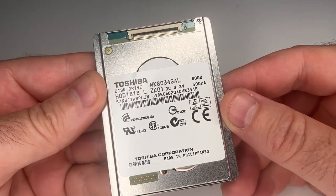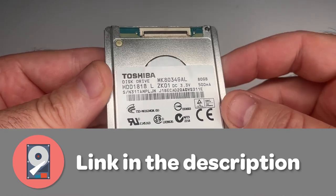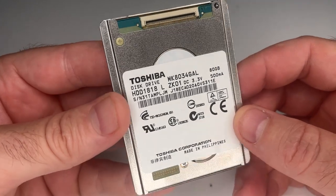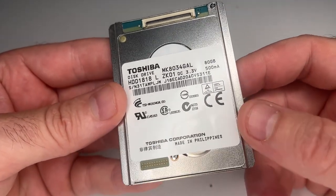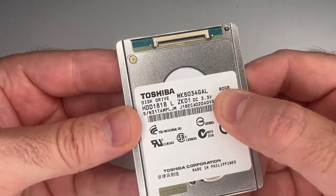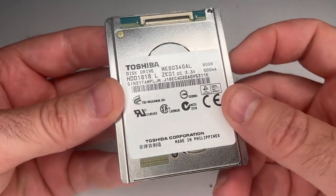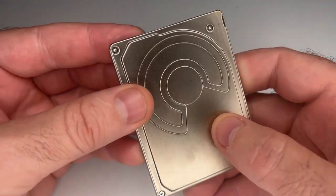And there's the little hard drive that's inside — these are known as a 1.8 inch hard drive. These are the same hard drives that powered the original iPods, and they're obsolete now. These haven't been made since about 2009; they got as much as 320 gigabytes. Once solid state flash memory came out, all these micro hard drives disappeared from the market — they're no longer made.